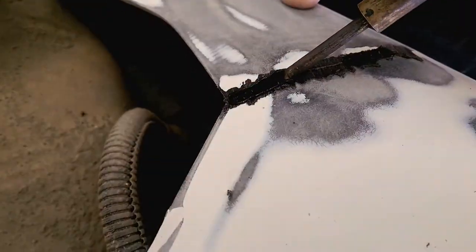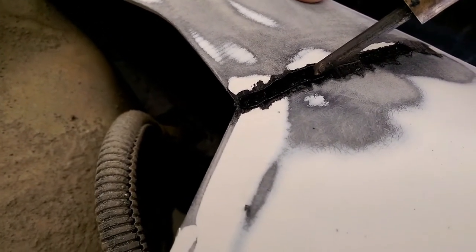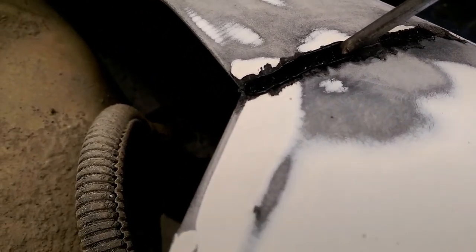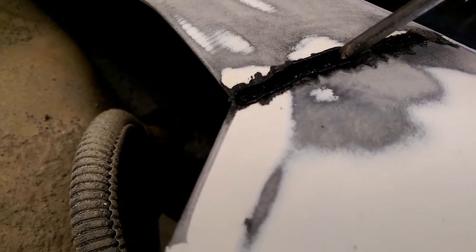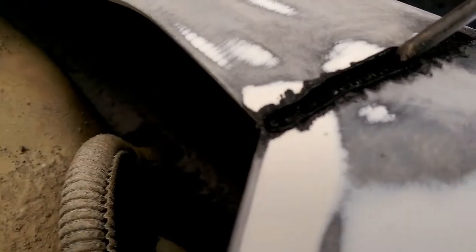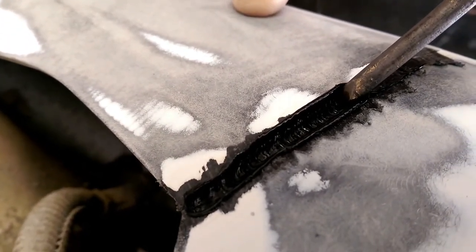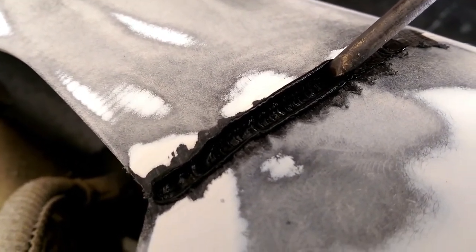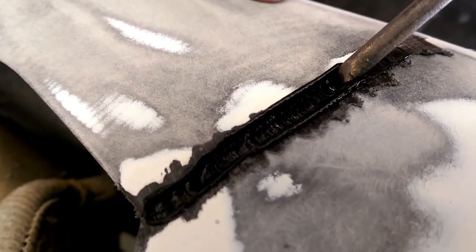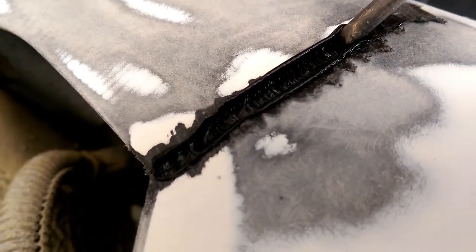What you want to do is basically melt a big groove once you get your bumper situated back in the position it's supposed to go. That way it melts deep down in the plastic while just pushing back on itself, just like you see in the video. And just take your time, because you can't build something nice in a day. Well, you can, but you know what I mean.